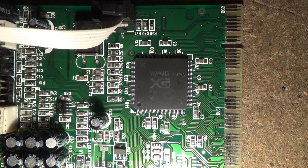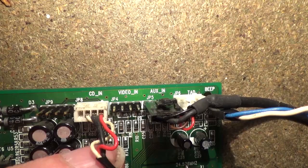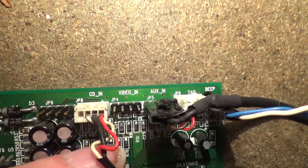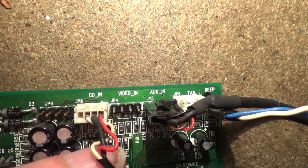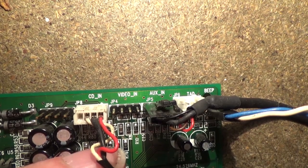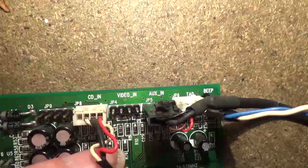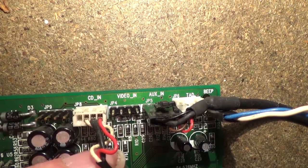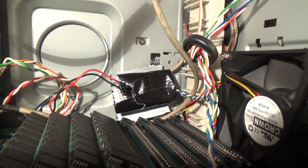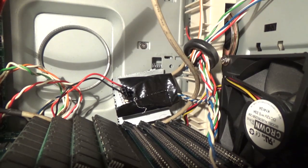Not only due to the lack of analog input in such a mode, but also as there's no SPDIF input on here. Now, these kind of things seem to be common with Yamaha 724s in general, which I wasn't so aware of when I made the video about mine that I used to have. Also, be warned that the card maker has omitted some vital circuitry from the PC speaker input, so you'll have to build some kind of voltage divider or stick a matching transformer in if you want to avoid melting some wires when connecting that up.